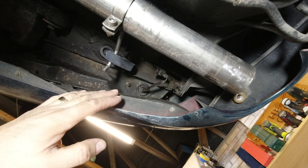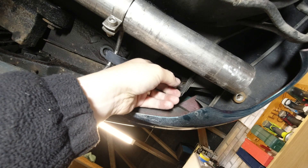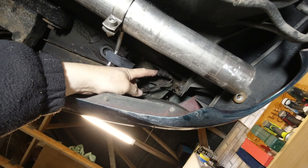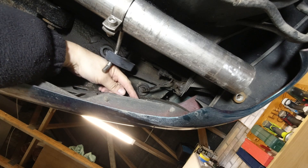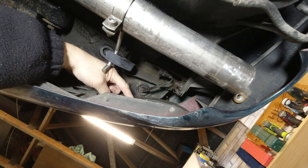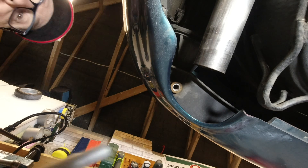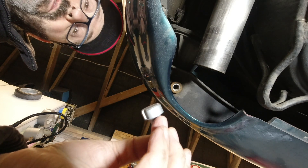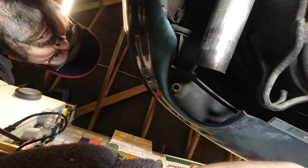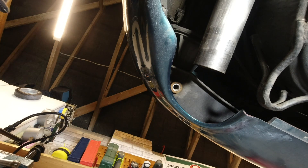While we're in this area — if you look up here there's an electrical connection on a British car where it's just hooked up to a clip. If this was an American car, that electrical connector wouldn't be on the clip; it'd be plugged into the back of the reflector where there'll be a lamp holder. So should anybody have a need or desire to illuminate their reflectors, that's the cable you need to attach. Installing these bolts is as simple as it would appear — all I will say is put some sort of copper grease, copper slip anti-binding compound on these bolts to avoid future spinners.